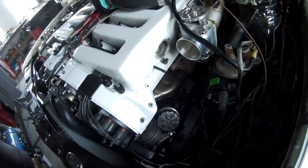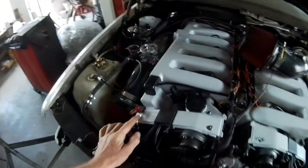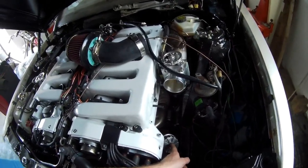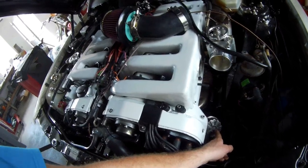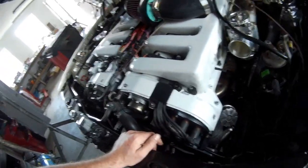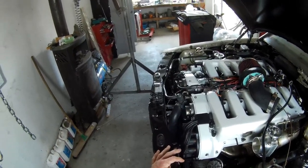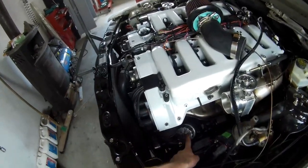So what I did is just fill up the complete system, and the pipe to the bearing point is filled up. The sump is filled up. It's a little bit over level, I think about 300 milliliters over level, but that will be okay, because it needs to fill up the filter completely, and there's like a liter of oil in there, so it needs another 3 or 4 hundred milliliters, and it needs to fill up the complete oil lines in the engine block, because I think it will all be drained out, most of it. I think only the bearings will have some oil in them. And the complete system should hold 10 liters of oil, so then it will be completely like I have now, because there's 10 liters of oil in the system. So have a look at the photos down below.